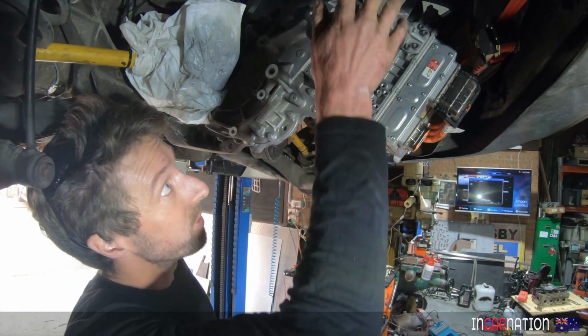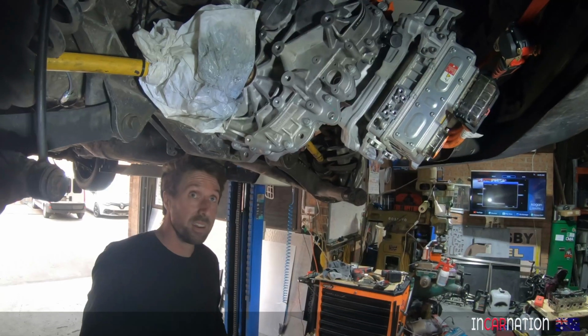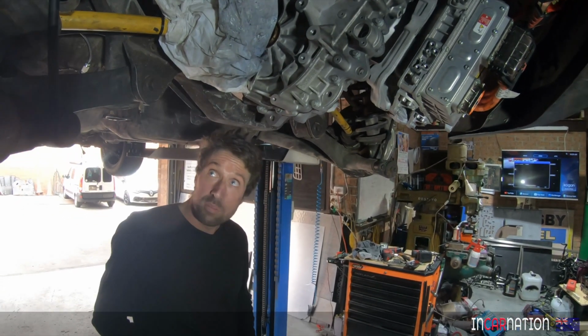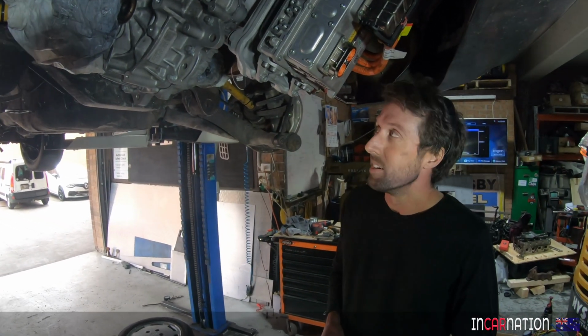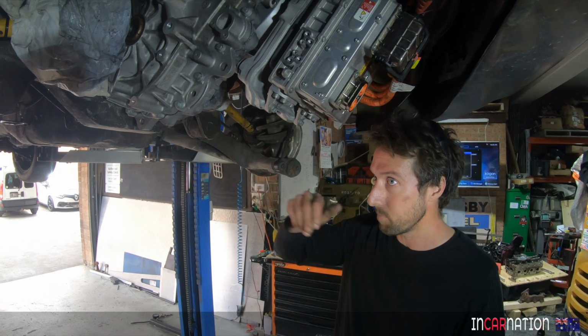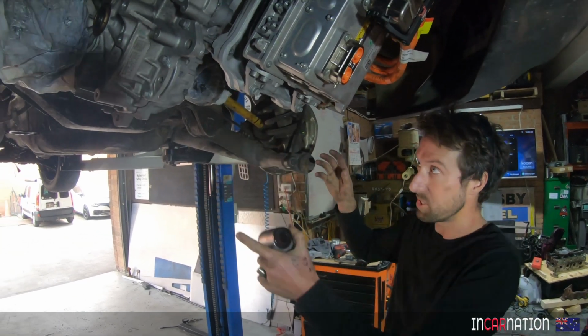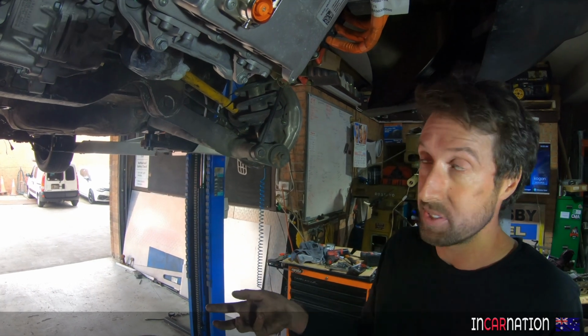Once we get that, we've got nothing on top of the motor, so you can look at the electrics and where stuff's going to get mounted. Then I can hear you thinking about axles, how we're going to do that. I've got an idea. Suffice to say, we're using the MG inners and the Porsche outers, but how they connect together? We could get a custom shaft made from end to end once we just put the inners in, which is doable, expensive, takes a bit of time.